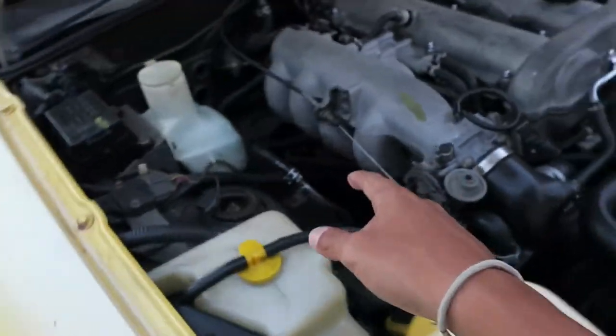Let's go underneath the car to inspect the slave cylinder. This is my slave cylinder and as you can see right there, we've got a big crack in the rubber boot. It's good to know that brake fluid constantly runs through this rubber boot, and over time it gets very hard and brittle. I can literally just pull it open with my fingers — it's just falling apart in my hands.